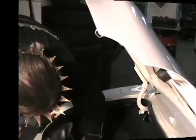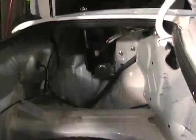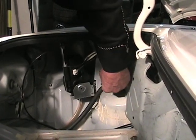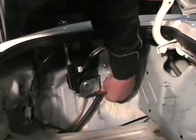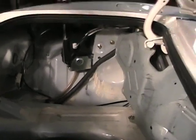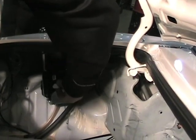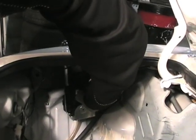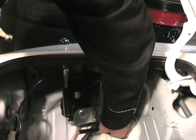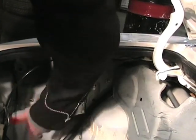Now we'll take a look at this other panel and move it out of the way. There's our antenna motor assembly. To get this motor assembly out, here's a nut that holds it in place, and there's a drain hose right here that we have to pull. We also have the same type of nut on top, an electrical connection with a little clip on the back — push in and unclip it. Here's our antenna mast and the leader that goes to the radio — unplug that and this whole assembly will come out of the car.